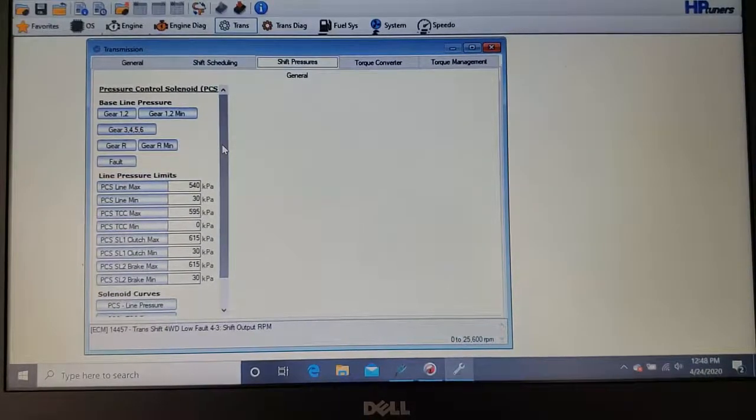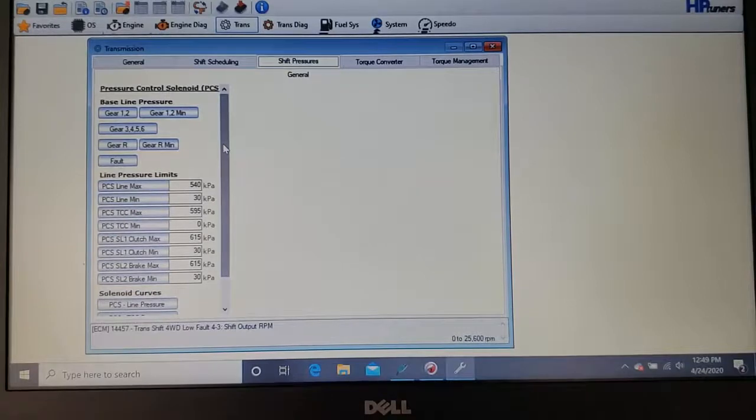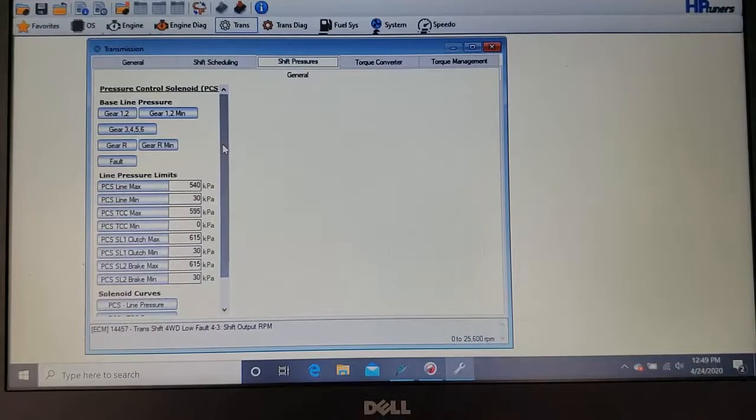The problem is we have a truck and we have leaf springs. You have too many pressure points. If you make it shift too hard, your drive shaft and rear end are going to be banging too hard. You don't want to shift too hard. You want to shift firmly and quickly, but not hard. You don't want to bang your drive shaft. You could, but then you're going to need ladder bars on there and stuff like that. This isn't a drag car. So with the stock type suspension, you can only want to shift so hard.